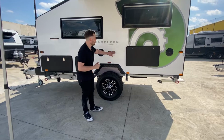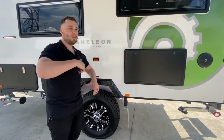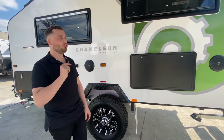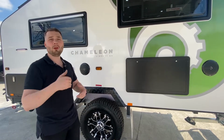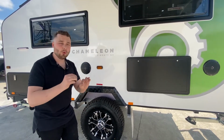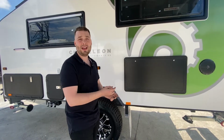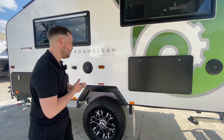Not a piece of timber in the construction material of the wall, the roof, the floor, the front, the back, any of it. This guy here is a fully engineered composite panel: 32 millimeter roof, 32 millimeter floor, 32 millimeter walls left and right, 32 millimeter back. This thing is fully insulated. You can almost breathe hot air and it'll keep the hot air in it. It is ridiculous, but still, they've gone for the diesel heater, so we can't wait to be able to show them how hot it's going to get.